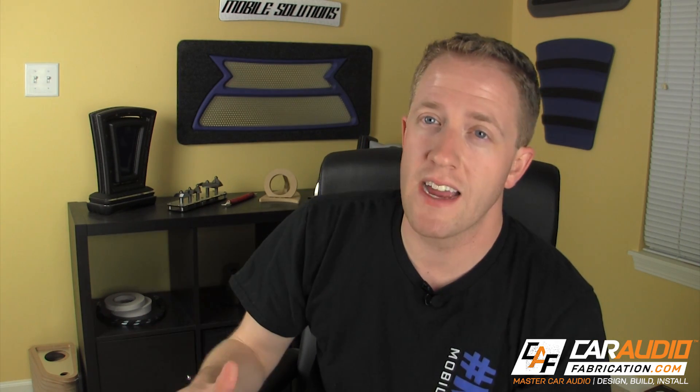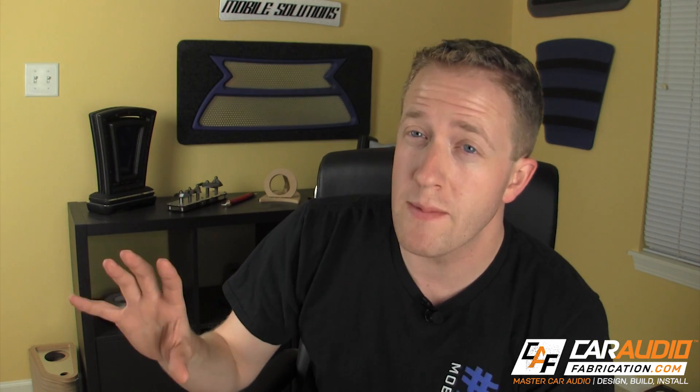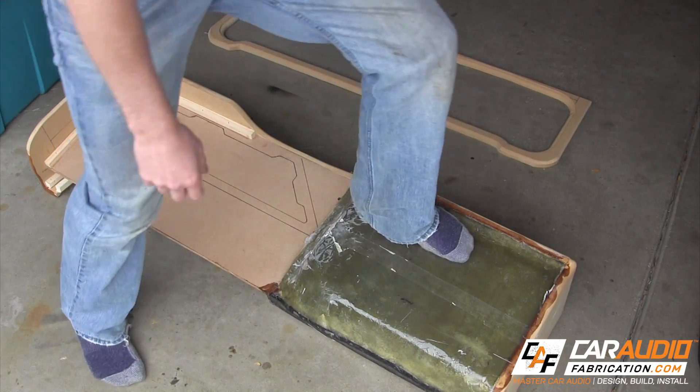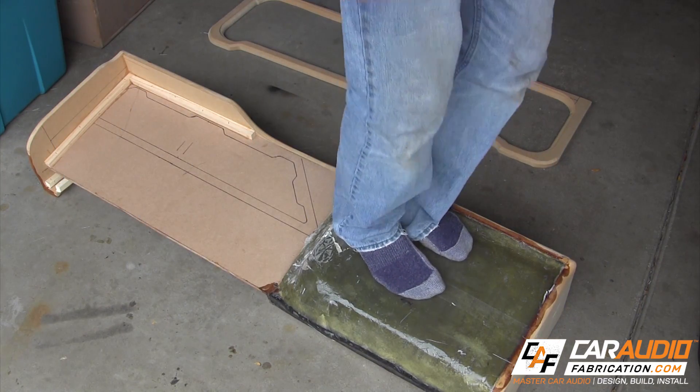There's going to come a point where when you push on it with your thumb, it won't deform at all. If you're doing a fiberglass door pod or something for a smaller speaker, that's probably good enough. But in the case of a subwoofer, we need to do an additional test — with a subwoofer, it's critical that there is no flex whatsoever. The test I'll do for a subwoofer box is literally put my whole body weight on top of it. The part should not deform under this 200-pound load.